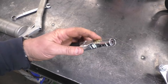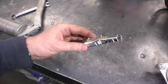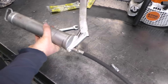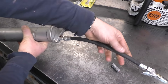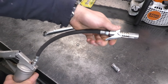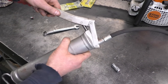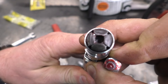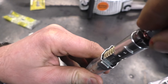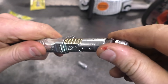I like to use the Lock and Lube on bigger equipment like lawn tractors and vehicles because sometimes with a regular grease gun you have to hold it with both hands, and it's hard if you don't have a third hand. With the Lock and Lube, you just put it in, lock it, and squeeze the arm for the grease to come out. Here's another close view — squeeze the lever, grease fitting goes right in, and it's locked.